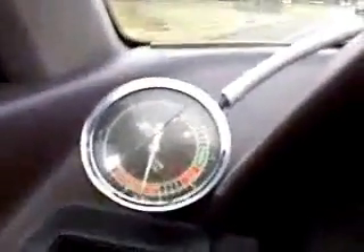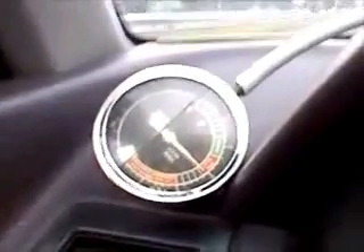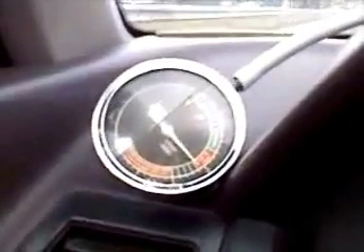I'm cruising along the highway right now, just coming up on an entrance ramp. I'm in fifth gear, and that's seven inches of mercury — again, very light acceleration. Now I'm just sort of cruising along with the engine idling; according to the vacuum gauge this is still acceleration, so this must be a slight uphill incline.